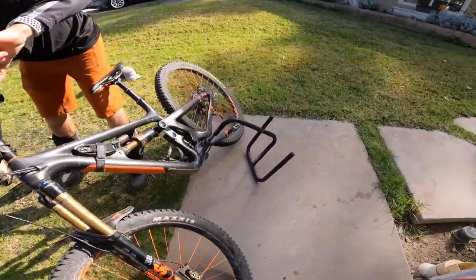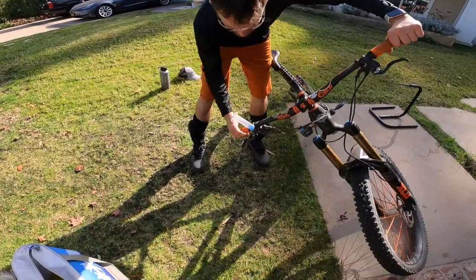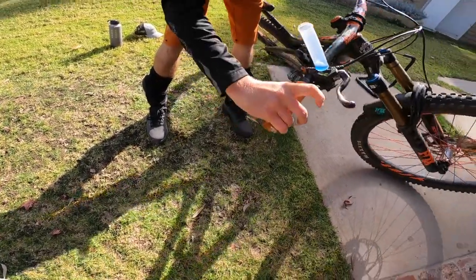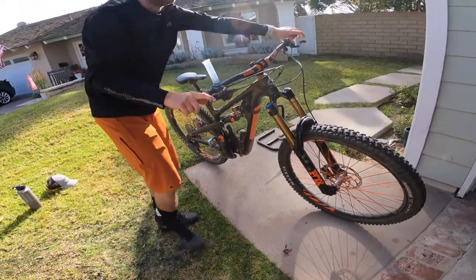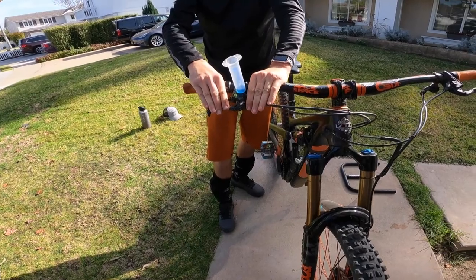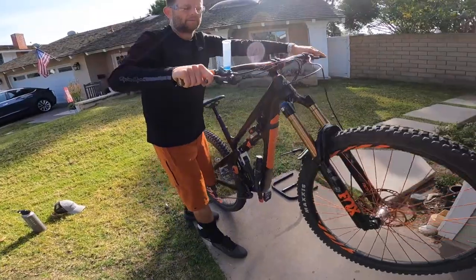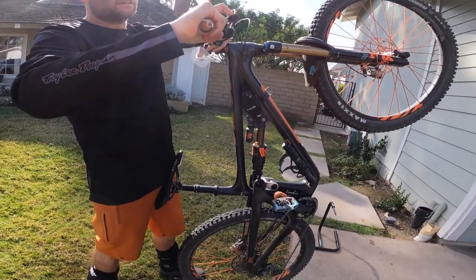Pull the scorpion stand away because we don't need it anymore. Turn the handlebar so that anything in here is coming — turn the bike and the handlebar so any air is going to rise up out of there. You can turn the bar around this way and that, just to make sure you got that oil out of any little corner. Next I'm going to tilt this guy back down — just small bubbles at this point — but I'm going to lift the bike back this way and see if there's any air in the line that's going to come up to the top.